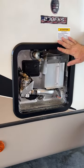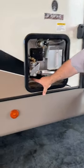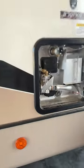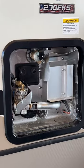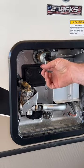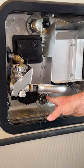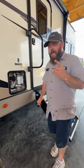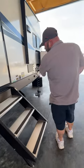Then we have the water heater. With your water heater, it has the gas-electric option. The gas option is controlled from inside on our control panel, which I'll show you in just a moment. For the electric, that's going to be located down here in the bottom corner. Whenever you are done camping, you do want to get all the water out of this guy. To do so, you're going to pull this up here to relieve the pressure, and then remove this guy down here — this is a 1 and 1/16 socket, and this is what they call your anode rod. This guy basically starts out the size of a dime and will work itself down to the size of a coat hanger. What it's doing is it's trapping the impurities in the water so it attacks that rod and not your tank, because it is a steel tank.